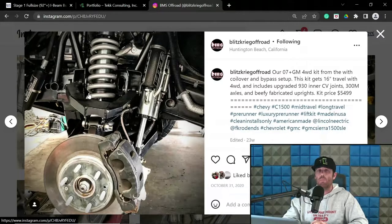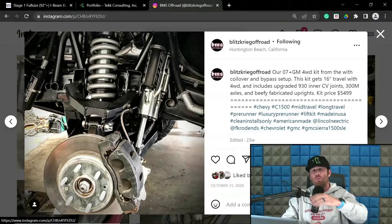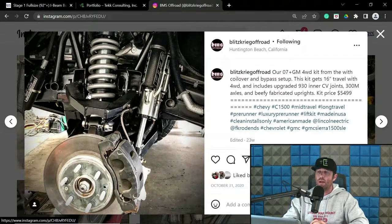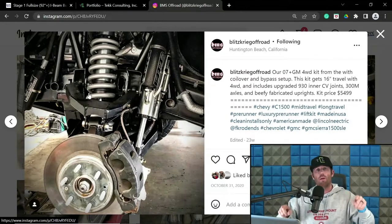The reason being is at compression, wheelbase will be several inches shorter. At extension, it will be a hair more than that. So it'll be like 4 inches shorter at extension, primarily because of the rear suspension travel arc. It swings forward at extension, swings forward at compression relative to ride height. So the best way to measure that is hub center point at ride height.